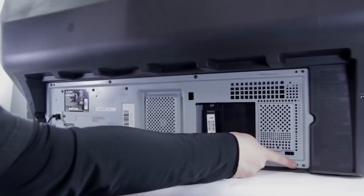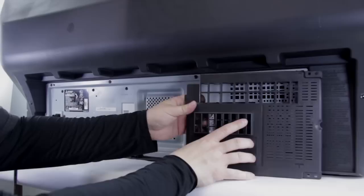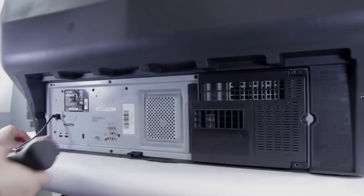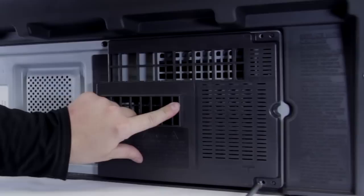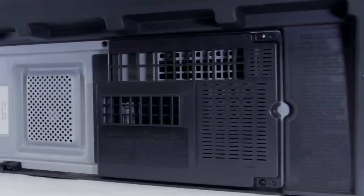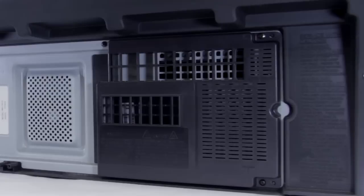And there we go — we've put the back back on. Now we've got to put the lamp cover back on. I just realized I actually put the screws in right here that hold the lamp cover in place, so I just undid those. Now we can put our lamp cover on — there are a couple of plastic tabs that are going to slide right into these holes, so you need to make sure you slide those in first. Then it goes over and locks in place. Take our two screws and put those in. Now we have the back cover on the TV. Thank you for watching one of our many tutorials here at shopjimmy.com — we strive to learn and share new TV repair tips every day. Subscribe to our YouTube channel and grow with us, share our videos with your friends and help us spread the savings.